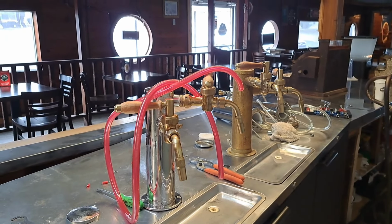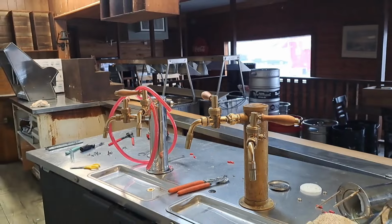And so I blasted home, and then my dad called me yesterday and said that the kegerator was not cooling down. So I came up again and found out that it was not running, and so I immediately went down and put my hand next to the compressor, and it was hot as shit, which can only mean one thing, that the compressor was actually running the whole time. So I opened the access panel down here